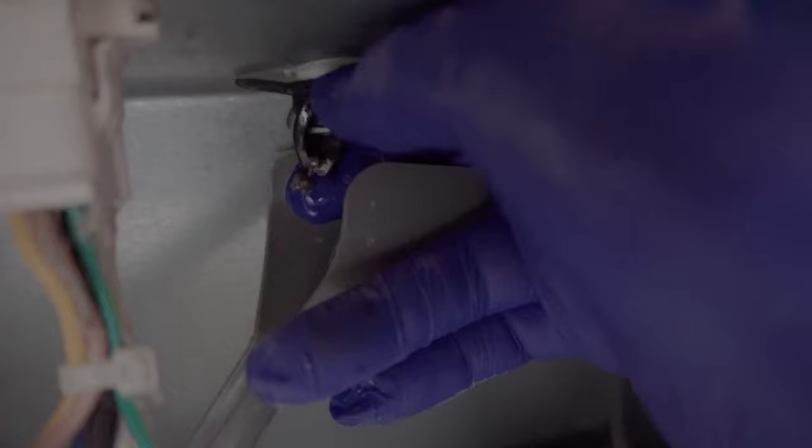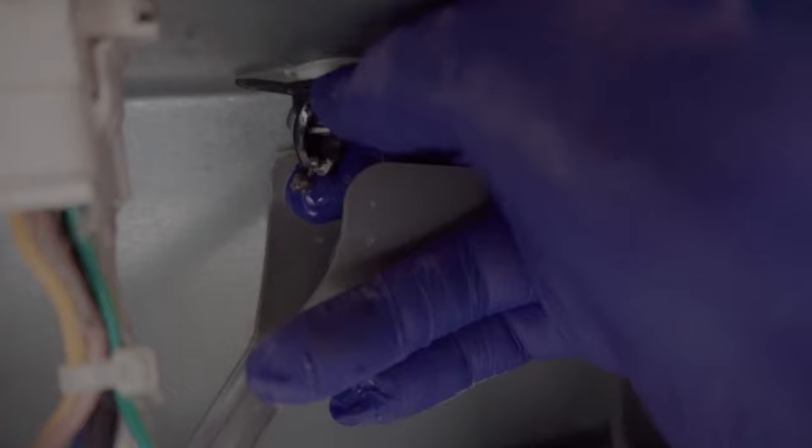You can see there's this little nipple on the very top and it's slowly dripping now because we started using the steam and it loosened up all that ice block. I'm going to squeeze this and check the inside of the nozzle — you can see on the bottom there are a few buildups with clogs, dirt and debris. I'm just going to use my fingers and unclog that, taking out all that dirt. I believe it's caused by the fan blowing dust and dirt over time — it accumulates there, so you want to keep that nice and clean so it doesn't cause blockage.